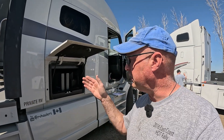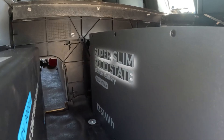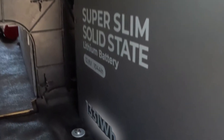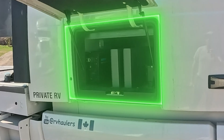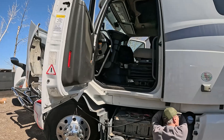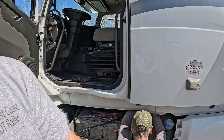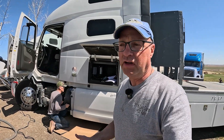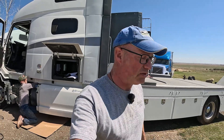The heart of what we're doing today is installing the super slim solid state lithium batteries — these are just over 1,300 watt hours. We've got two of them installed in the jockey box, along with the 3,000 watt pure sine wave inverter from Renogy. Those solid state super slim batteries are replacing four lead acid batteries installed side by side in this truck, and what the Renogy system does is remove the concern with thermal runaway — we don't have that thermal runaway concern we've traditionally had with some of the LiPo solutions.